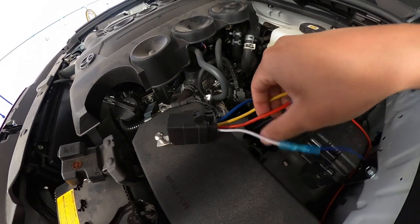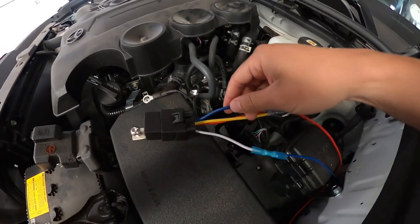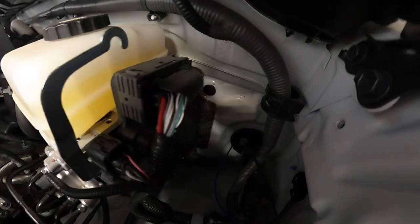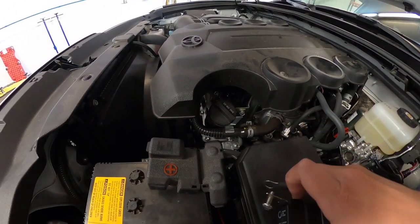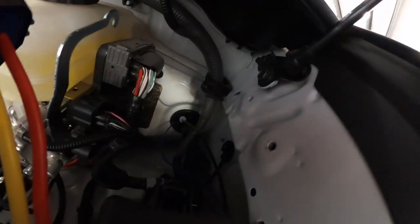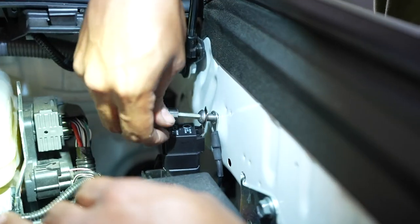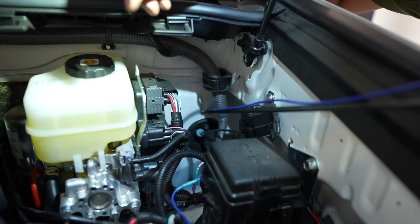The yellow and red wires are the KDSS module harness connections. The blue wire will be your power going into the battery terminal. The white wire is for the OEM-style switch — it's running to the firewall and will go through there to power the switch inside. The ground wire gets grounded into the firewall, and you can use one of the existing slots there. Once everything is heat-shrunk, we'll connect the relay and ground to an existing threaded hole in the firewall so we don't have to drill anything new.